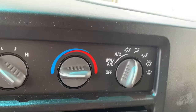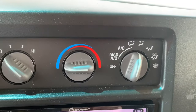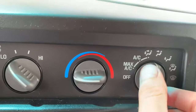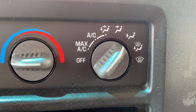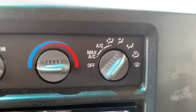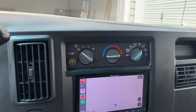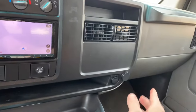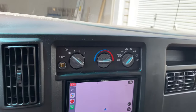You'll hear a little bit of a hiss come out of here as well. I just replaced the vacuum check valve so this should work. You could hear the little bit of a hiss from up there, and I heard down there in the floorboard you could hear one of the doors actually closing. So this vacuum check valve works.